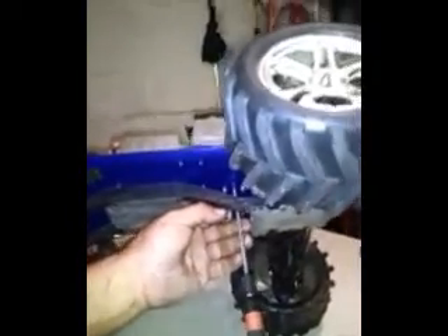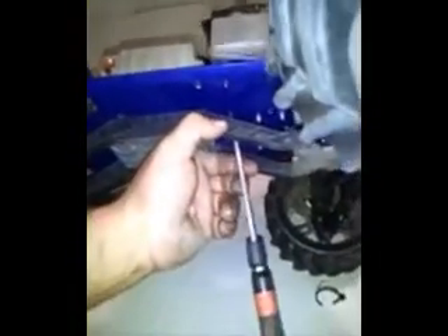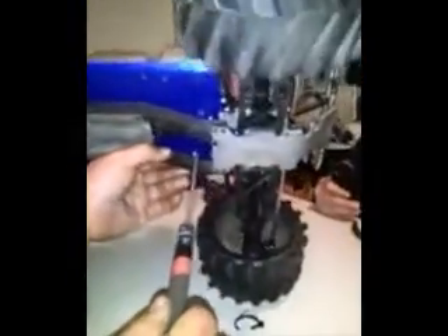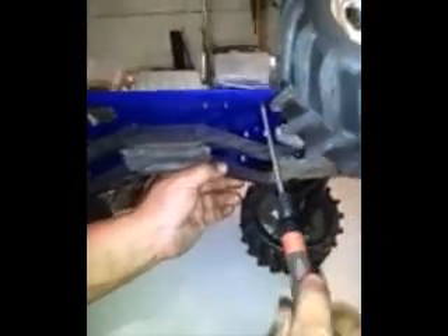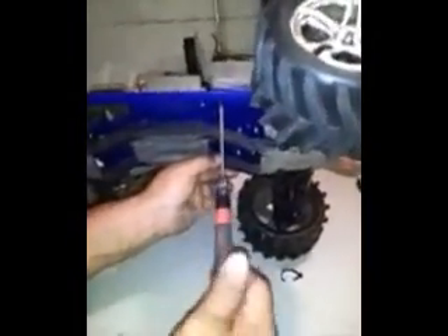On the bottom there are two bolts — those are the motor mount bolts. You want to check them, make sure everything's tight. It'll hurt not to have it tight. Don't over-tighten this one up here. Make sure you hook this pressure line back up, because it will be very hard — if not impossible — to start it without any pressure. This line pushes the fuel through your fuel line from your exhaust pressure. Take a needle nose, flip it back on.